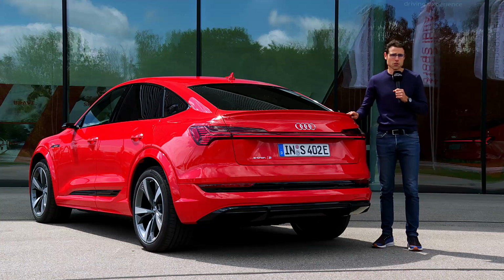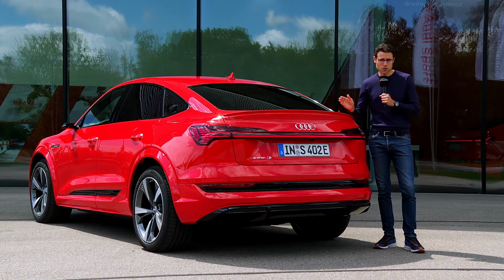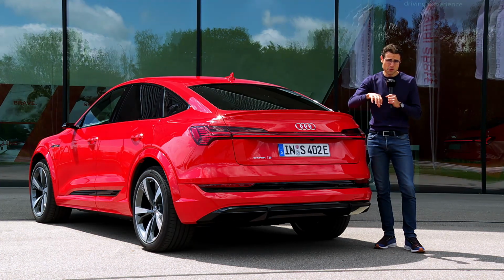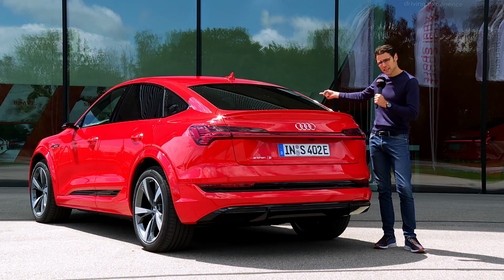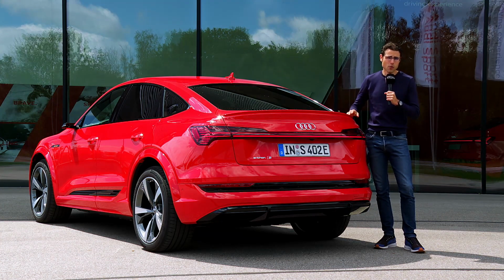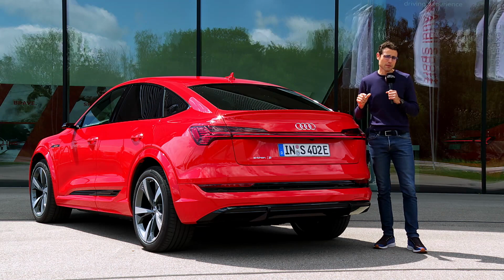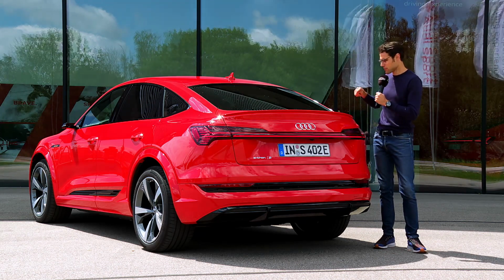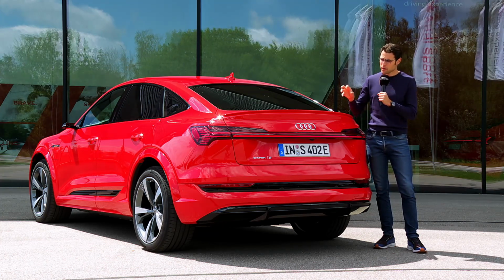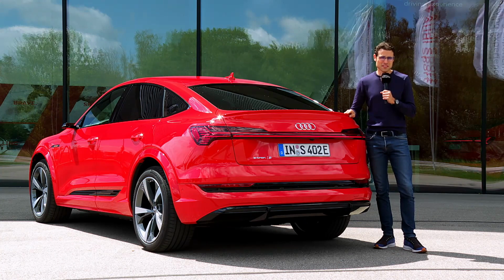And then let's talk about the technology, because this is really different here with the e-tron S. So usually you have an electric motor in the front and also one at the rear. Here actually they moved the rear electric motor from the normal rear to the front of this car, and then at the rear they put two electric motors, one per side, one per wheel. So overall 3 electric motors, and because they are separate electric motors here at the rear, this enables an active torque vectoring, so you can have, for example, more power at one side when you are in the corner. That is in difference to a passive torque vectoring where you use brake intervention to create the power difference between the wheels. And of course, we will experience this one today on the racetrack.